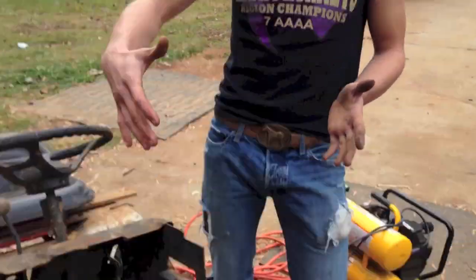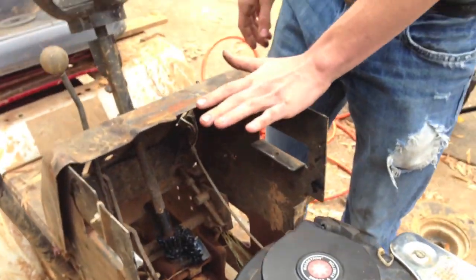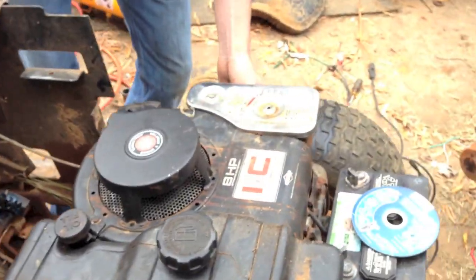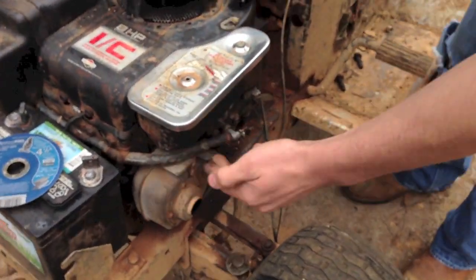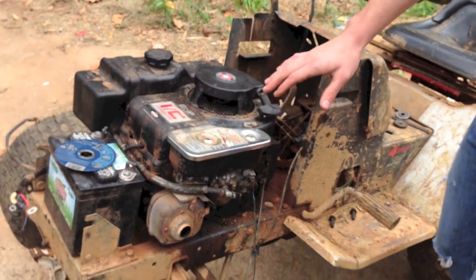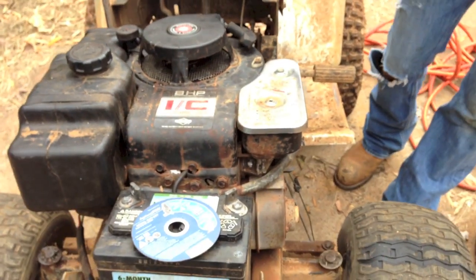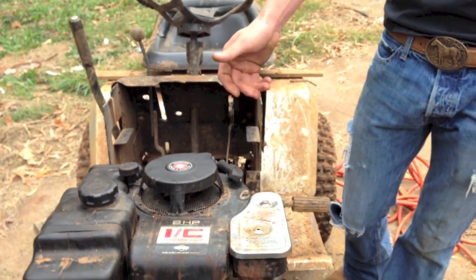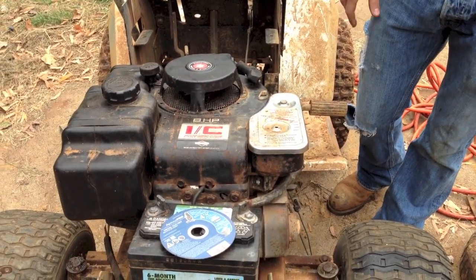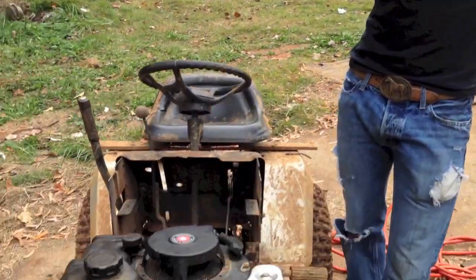It's just got a real beastly look to it. I'm going to run two gas tanks — get a splitter and put my other gas tank back up here, and run a splitter down to the carburetor. If I'm on an incline leaning to the right, this motor kind of wants to bog out. With a secondary tank, I can ride up and down steeper hills and slopes. I'll be carrying around about six or seven gallons of gas.